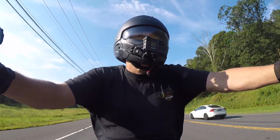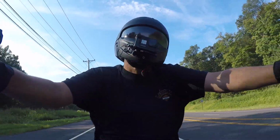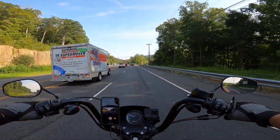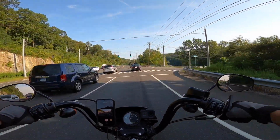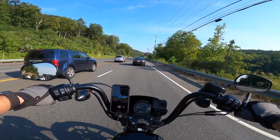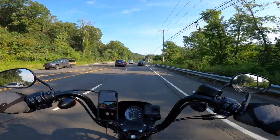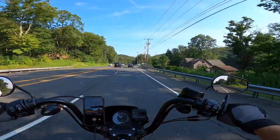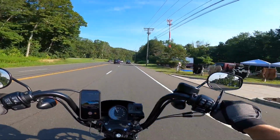There's a crack somewhere in one of the carburetors, so that gives you a hint, guys. It's a carbureted bike. Another issue with it, he said, if it sits for about 3 days, the battery will drain, and it's got a brand new battery in it. So there's something pulling on the battery. We'll have to figure that out. Not an issue. So yeah, carburetor issue, compression issue, forks, electrical.